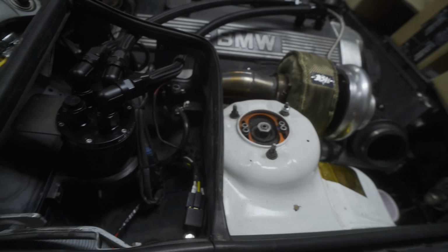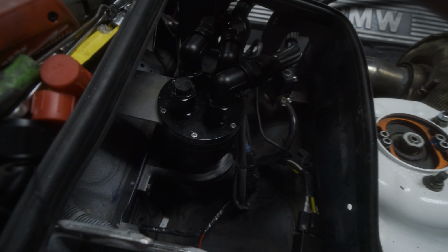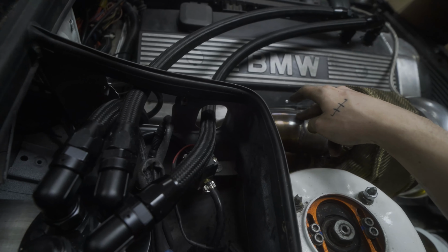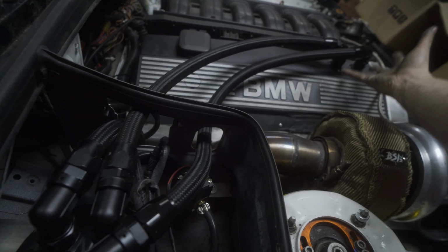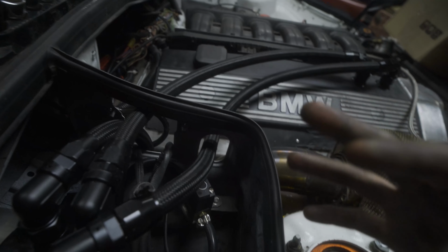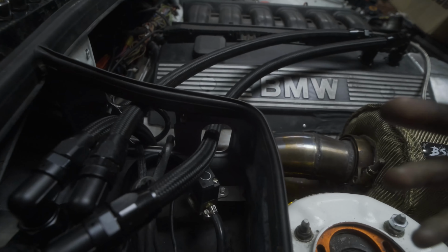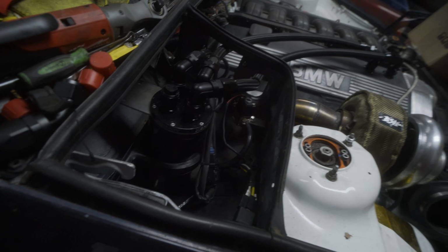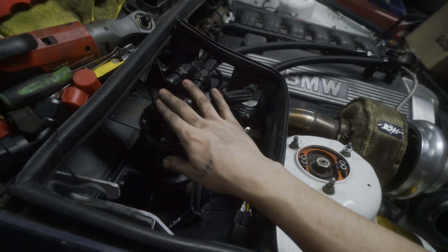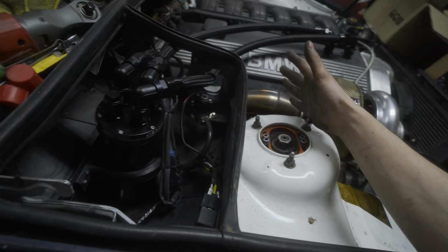I believe this is called a closed loop, and I have it here in my downpipe going to here on the outlet side of the catch can. So this is going to cause a vacuum when the car is running or in higher RPMs, and that will help pull the positive pressure out from the motor. So that should help everything breathe, help maintain the gaskets, and also, since it's going to be venting through the exhaust, it's just going to mix with that and not cause odor in the car. So yeah, that's my long-winded explanation of why I have this set up the way that I do.